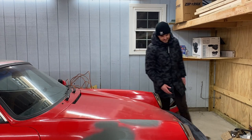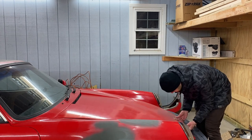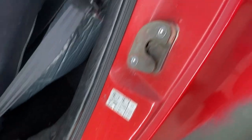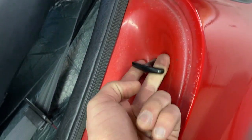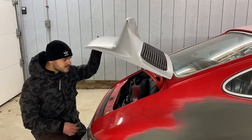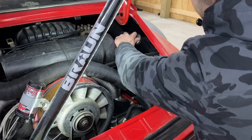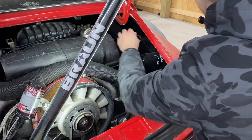One of the most basic things when checking out a car is checking the oil level. It's a little bit different on these cars. You might forget really quick that, yes, the engine is in the back. So instead of opening the hood and looking like a rookie, make sure you go back and open the deck lid. You do this by actually pulling the knob on the driver's side door sill and it opens the rear deck lid. Once you got the rear deck lid open, the oil fill neck is actually to the passenger side area of the car. You're gonna go ahead and unscrew the fill cap and you'll see the dipstick hiding a little bit towards the rear.